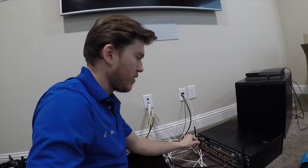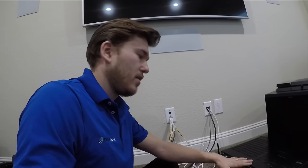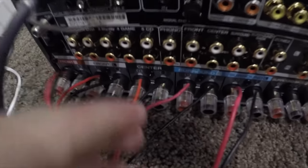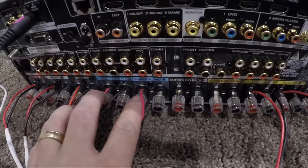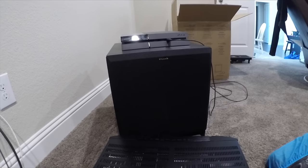We're making our connections right now on the amplifier, and I want to explain the different ways you can configure this receiver. This is a 9-channel receiver, meaning I could do a 7-channel system with zone 2, or I could do a 7.2.2 Dolby Atmos, or a 5.2.4 Dolby Atmos — there are many different ways to configure it. In this particular situation, what we did is front left and right, center, surround left, surround right — a 5-channel system — and we're hooking up one sub using the Klipsch SPL 12. You can also do a second sub with the Marantz 6013.